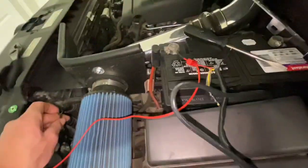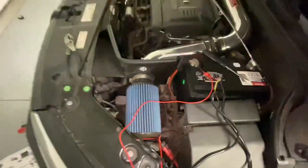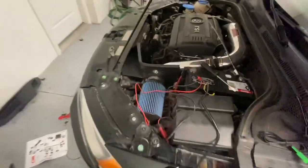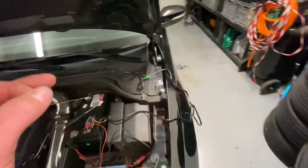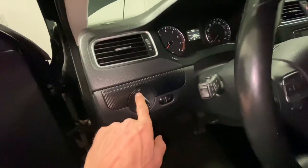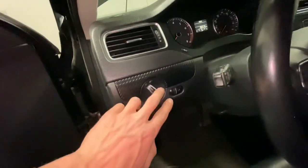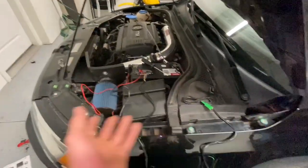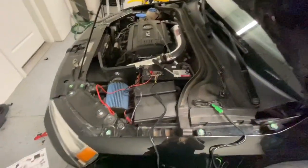I'm probably going to make this all work but simplified, because all this wiring is too long. I'm going to have to chop it up, solder it nice, and shorten it. Then I'm probably going to buy a different switch off the internet that fits in an OEM spot — like a more expensive kit does. I only have off and low beams right now — I want off, low beams, and fogs. When I buy a switch like that, I'll wire the fogs into the switch. Until then, I'll ball this up and zip tie it somewhere out of the way.